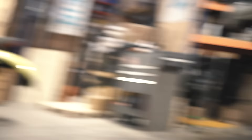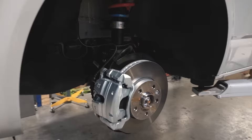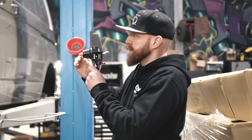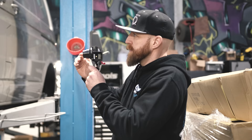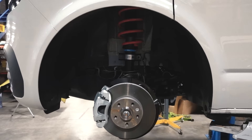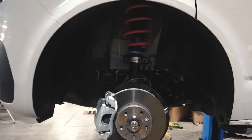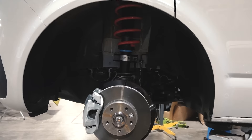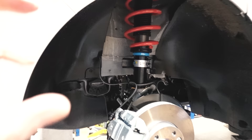This is the new Solo NXT — your standard drop coilover. It's very similar in drop to a lot of other coilovers on the market. This is for you if you want to be lower than a spring but really retain comfort — the ultimate in comfort setup while getting around a 60mm drop. This came from us working with Bilstein on the B16 damper, which is a fully adjustable damper and adjustable height. After having it on one of our vehicles for a while we found the sweet spot and it just stayed there. That got us thinking — what's the point in creating an adjustable damper if we found the perfect point? So we took that damper back to Bilstein, got on the damper dyno, worked out exactly how it rode, and that's where this came from.